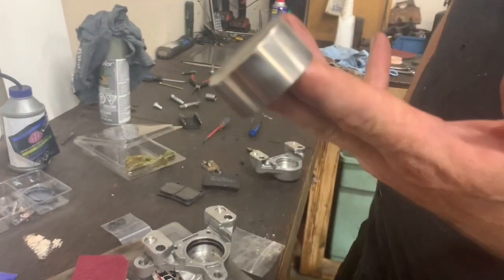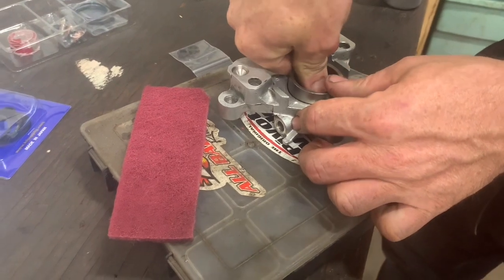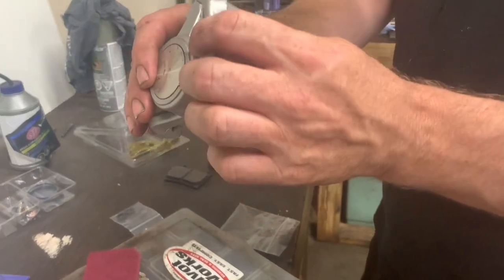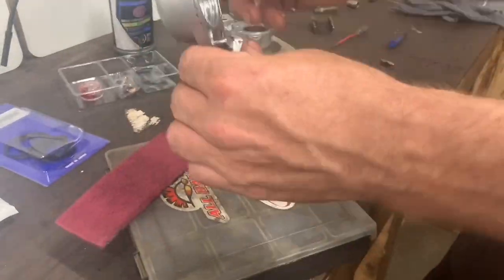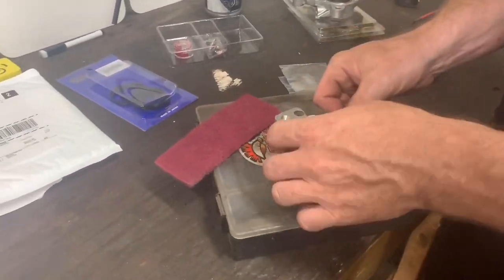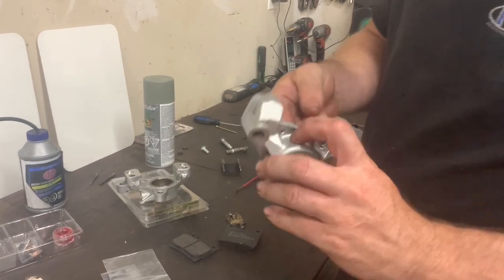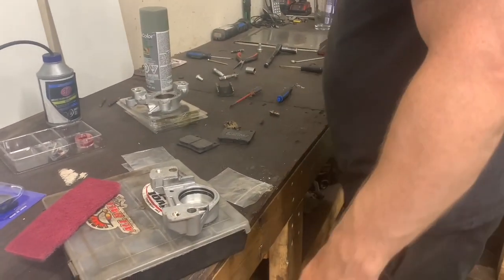These look pretty bad when they got the rubber all stuck to them, and you first take them out, but they clean up nice. Is that what you wire wheeled yesterday? Yep. That's all it takes to put them in now, C-clamp or whatnot. You don't need this special grease, you can just use the brake fluid. Oh, that just came with the kit, wasn't it? Yeah.